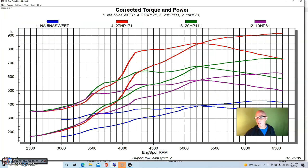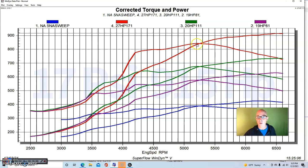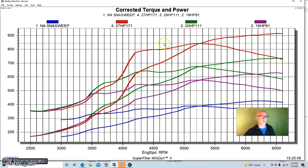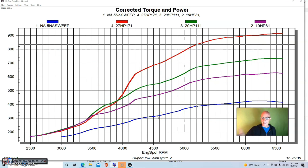Here's what happened when we turned it up to 17 pounds — we actually ran a bunch of different boost curves in this testing. This thing eventually got up to near a thousand horsepower. But even at 17 pounds we were looking at 915-916 horsepower; peak torque checked in at 844 foot-pounds of torque. You can see it's just kind of railroad-tracking. If we look at just the horsepower: NA, boost, more boost, even more boost — it just keeps going up and up.